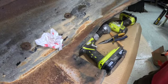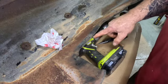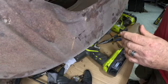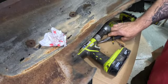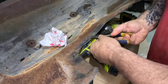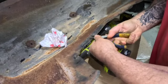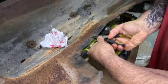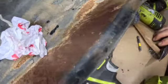Here's something I've always found a bit challenging to get out — there's a rubber mud guard that fits in here and from the factory it's stapled in. You can see the backside of the staple right there. What I do is just take a good strong pair of needle nose pliers. You've got to straighten the bent hook on these. Some of them just break off, which makes life a little easier. Some of them aren't so brittle though — they straighten out like this one did.